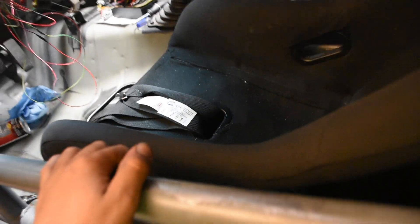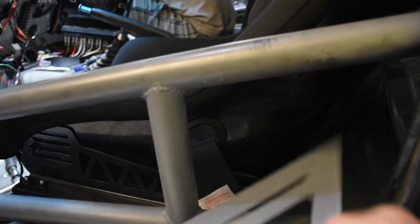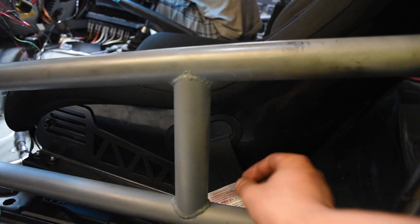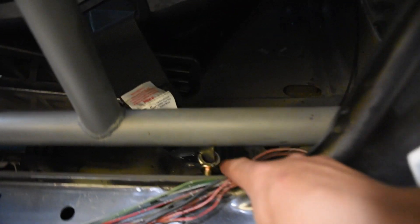The two points going to the floor are now coming through the bottom of the bucket seat. Now that the anti-submarining belt and shoulder belts are installed, next we move on to the lap belts. Check with your regulations to figure out what angle you need. An easy way to tell the angle is to use an angle square — set it so zero is flat and read off the angle. Ours is at 55 degrees, and our rulebook allows a minimum of 50 degrees and a max of 80. We're good using the OEM mounting location on this side, and I'll line it up and drill a hole to the trans tunnel to mount the other side.